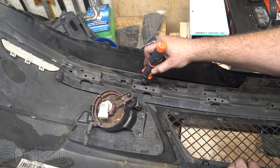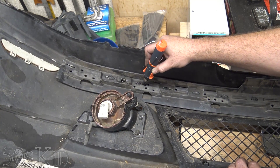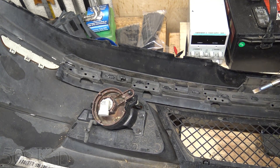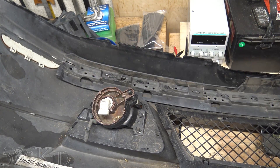That's working pretty well. I'm just making sure that I melt into both pieces of plastic so I get a good bond. Might not be factory original, but it's the same thing — it's gonna work. Seems to have worked for these pieces here. I'm missing this one over here on this edge and the same one on the other edge, but that's probably not gonna matter.